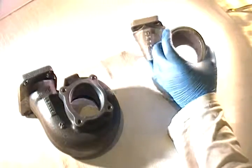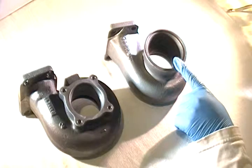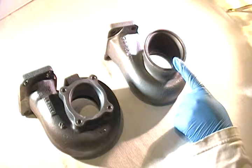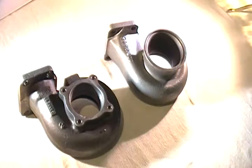What they typically do is cast one like this, but for proprietary reasons it's not a full three-inch outlet — it's usually 2.75 or 2.85 inches or close to that. So you really want to make sure that their V-band and flanging system all work with that particular turbo. But if you change turbos over to a Garrett or something else, you can't use that V-band flange system.